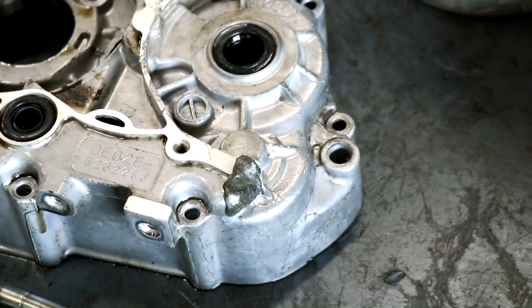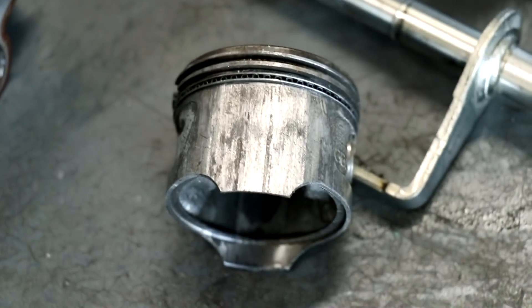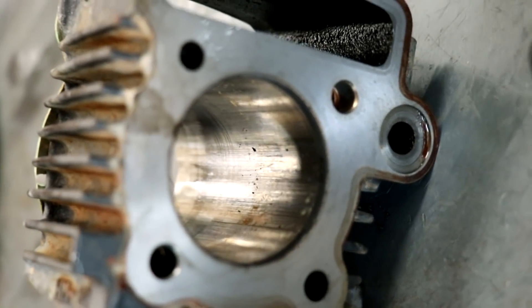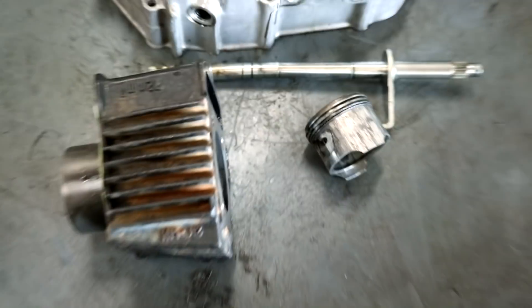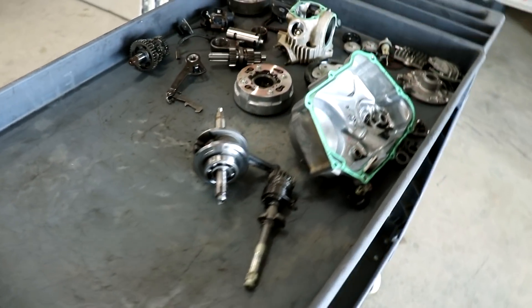This motor is now 100% taken apart, and here's the final damage report: the left crankcase was repaired with epoxy, we've got a bent shift shaft, and because of the lack of oil the piston and cylinder are pretty scraped up — there are some pretty good sized gouges in the bore. I'll be tossing out the cylinder, piston, and shift shaft, but the crankcase is still salvageable. The rest of the parts are in really good shape thankfully. Now it's a matter of cleaning all these parts up and adding them to my website — click the link in the description to check them out. I also mentioned a 20% off sale on the website for three days, so you only have two days left to take advantage of that deal. Alright guys, thanks so much for hanging out with me and I will see you later.